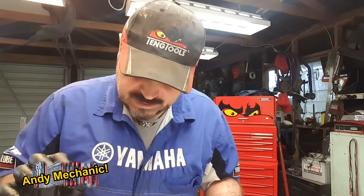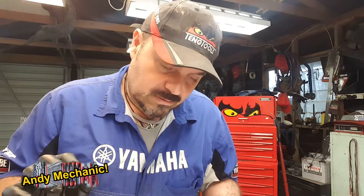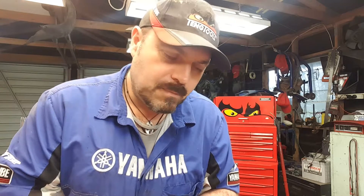So say 26.96 — yes, just. We're okay, we're in spec. Quite happy with that. It's a pass — that particular journal is okay. Now, obviously, there are other things you've got to look for as well as just doing the measurement. You want to make sure it's not scored or cracked or chipped or gouged — it's got to be a smooth bearing surface. If it isn't, you need a new camshaft.